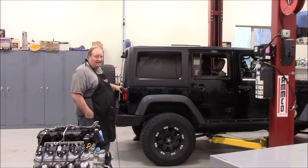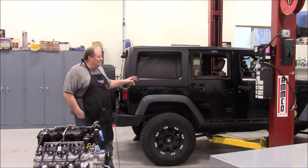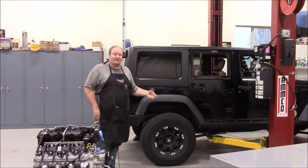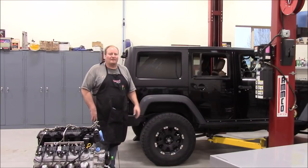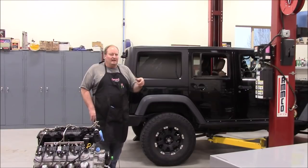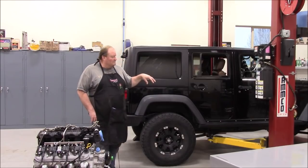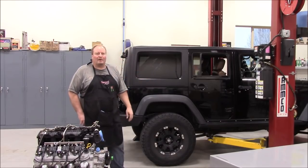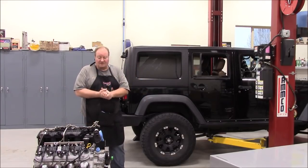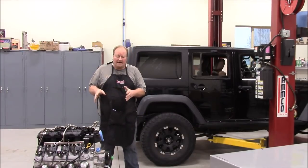The tow wiring pops out back by the left tail light and ties in, then runs up to the front under the bumper where I plug into the coach. I'll pull the tail light and disconnect that. Other than that, it's just going to be factory connections and factory wiring. A few relays and so forth on the firewall — I'll probably just disconnect the load side and leave the control side and everything tied to the body as intact as possible.